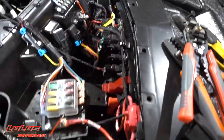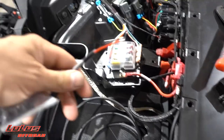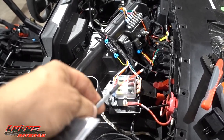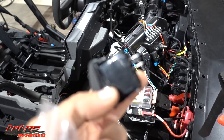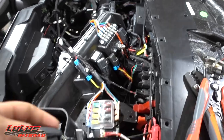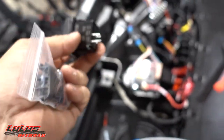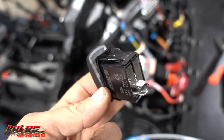I've got the wire ran through and attached to the cable that runs inside the channel, all coming out above the subwoofer. This black wire goes to power and ground. I'm not going to use the XTC power supply controller on this device because the Razorback switch is just for the dimmer — running it through there won't work right. Instead I'll hook up power to the bus bar traditionally, and run this gray wire down to the dimmer switch. I'll put the switch in one of the extra slots on the dash.